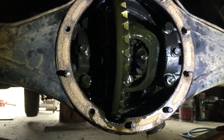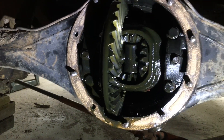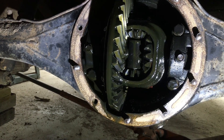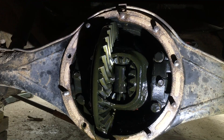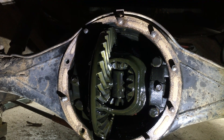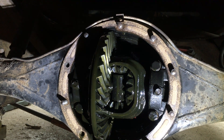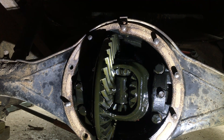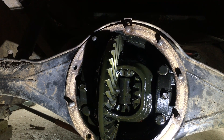It looks like the original cork seal is still intact, which is really nice — don't have to redo a seal on there. It's a semi-floating axle, and there's little c-clips on the end, so I've got to get those c-clips out, and then I can take the axles out, and then the diff can come out. I know how much I don't know about diffs, but this is a farm one and I might as well give it a go. I can feel that the lash is far too much, and it's pretty complicated — it's not just a case of tightening up the lash. It depends on the contact pattern and a whole lot of things, but we're going to give it a go.